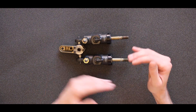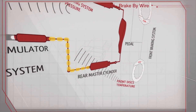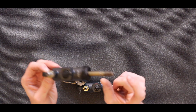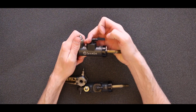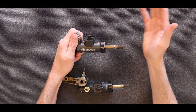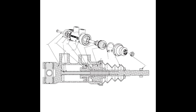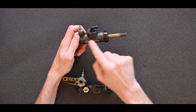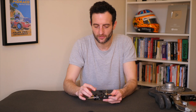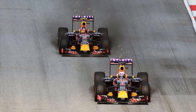So let's start with the master cylinders. There are two master cylinders — one for the front braking system and one for the rear. The rear nowadays is handled by the MGU-K, which I'll go into more detail on later. We've got the shaft here which is connected to a piston inside, and when you get on the brake pedal that's what compresses inside. Inside the chamber there's a piston and a seal which moves hydraulic fluid down the chamber and up through the fitting into the brake pipe. This little nozzle connects to the braking reservoir, which holds all of the braking fluid.